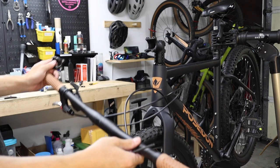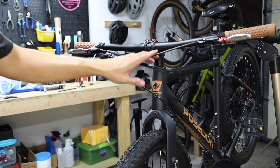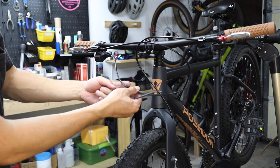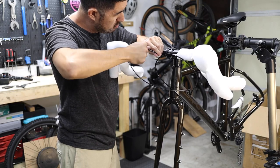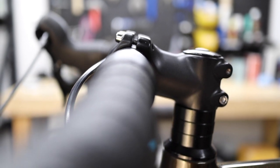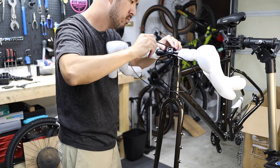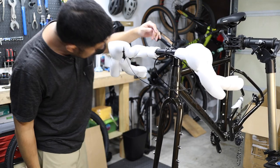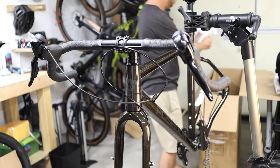For flat bar models, the concept is the same — you're trying to orient the bars so that the brake and shift cables have no awkward twisting. Shown here is the proper orientation for flat bar models. Reinstall the stem faceplate and cinch the handlebars down, aiming for an equal gap between the faceplate and the body of the stem above and below the handlebar. Roughly center the handlebars laterally, but we'll do a final adjustment and torque check later. You can now remove any remaining packaging on the handlebars.